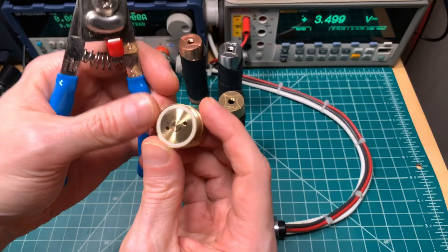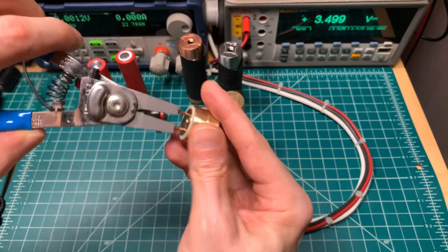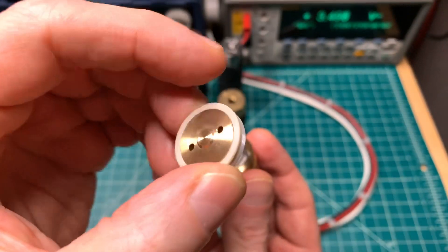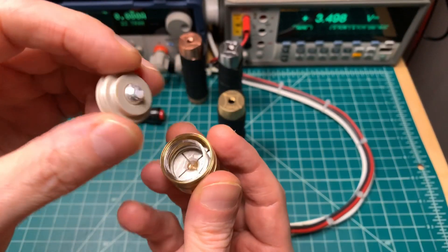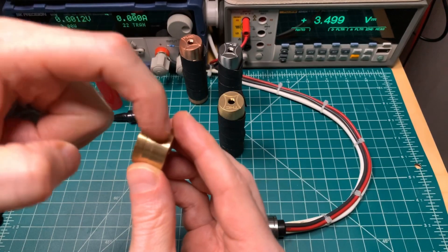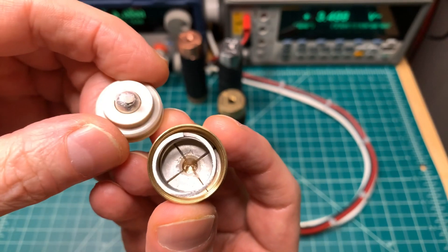The Tauren Max came with a tool — a piece of metal you could use to undo that. I have to use a pair of pin pliers. Hopefully this isn't in too tightly. When you get yours you can just use your fingers to get everything open. Here it is — that's what's up against the battery, there's some of the grease there. That silver ball touches the contact on the backside — that's just the four clutch plates with the spring around the outside. When the ball presses down into it, the clutch plates spread out to the side and pass the current to the housing, then through the threads and through the rest of the device.